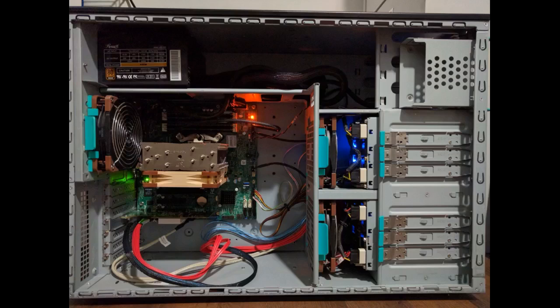Managed to fit this into a Corsair Carbide Series Spec 01 case. I have a Gigabyte 990FXA-UD3 R5 with an AMD FX 8320 overclocked to 4.5 GHz. I had to mount my top fans outside of the case to pull it off, and the door slightly hits the heat pipes, but it works. I also purchased the extra fan, and my temps barely break 50°C during stress testing. They usually sit around 25°C idle.